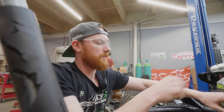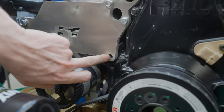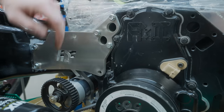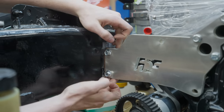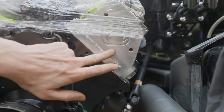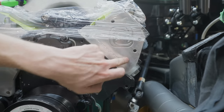I have one hole on the motor plate that lines up with one of the head bolt locations, so I need to make a spacer there. There used to be a hole there on factory GM blocks but the Dart block doesn't have one, so I'm going to have to drill and tap that hole — there is a casting for it to happen. Dylan is machining up the other engine plate because this head sticks out 39 thou past this face, so he's machining a relief cut on the back side so when we bolt it tight it'll be square and flat to both faces.